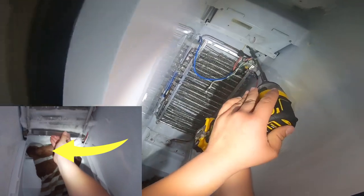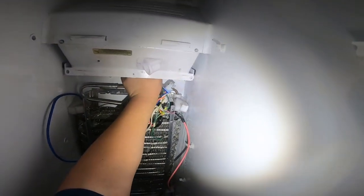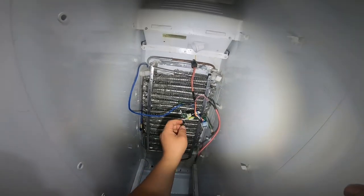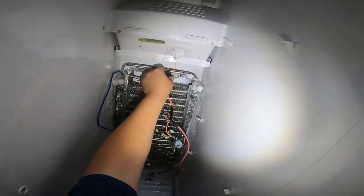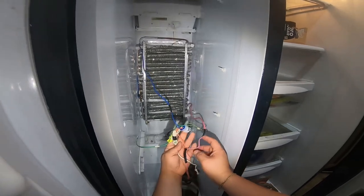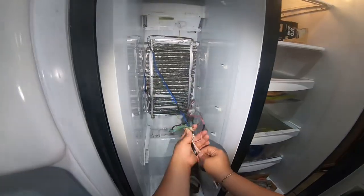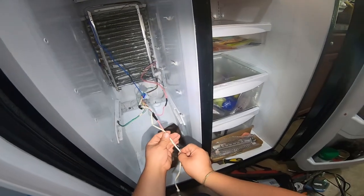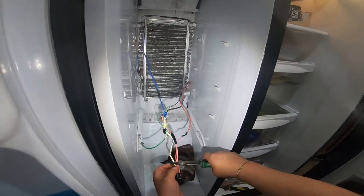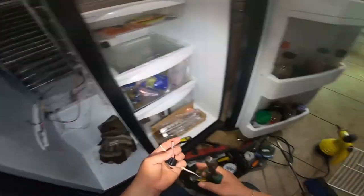I'm disconnecting the wire holding the harness — it's a ground wire; sometimes the screw can fail in the back, so keep an eye on it. This is how it looks when you remove everything. I'm working this way to show you better, but if you can work in the refrigerator without disconnecting that ground wire screw, that's up to you. I'm going to calculate how much wire I need, then cut the wires for the defrost thermostat and thermistor right there.